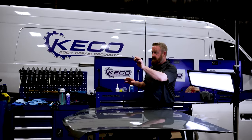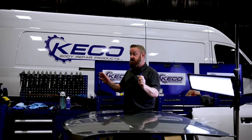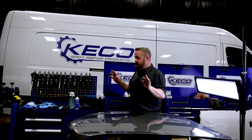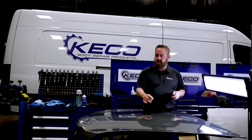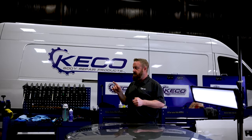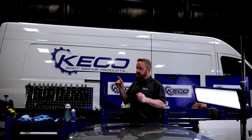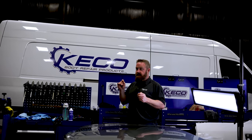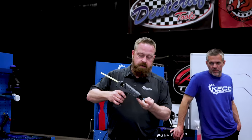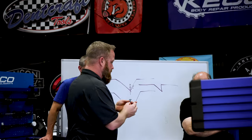Now, that little lesson becomes a great crutch. We've been talking about clean, clean, clean. That's the first C since we started teaching you yesterday. Good news, one little tiny dot of Sharpie is not gonna hurt your adhesion. So you can use it as a crutch. So now we can take our time and read the light, and then we don't need to read the light, we just need to place our tab over the Sharpie. So we've placed the dot in the middle of the dent, our oversized one.